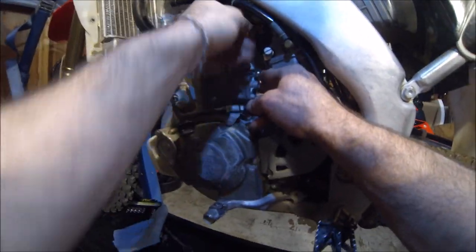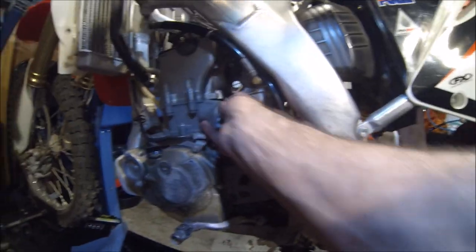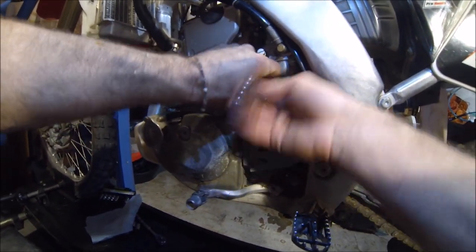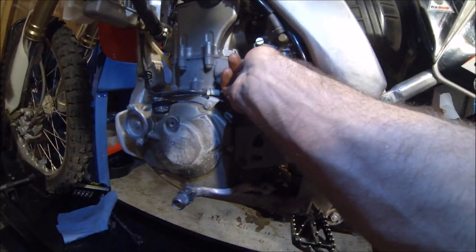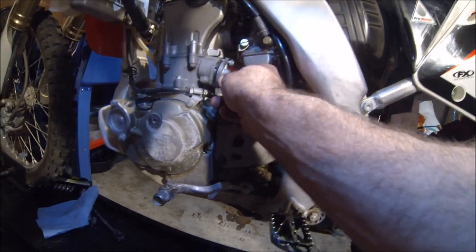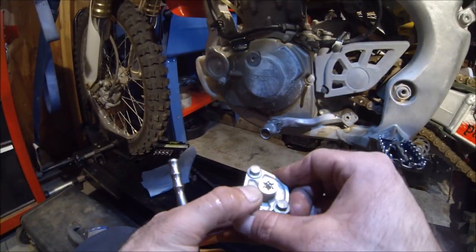It's a little bit easier. Leave the bottom one where it's at, that way you can take the top one off by finger. Go ahead and loosen it up here, try keeping it as even as possible. Okay, got that one loose. Make sure you can see there's a little dot that's going to face towards the left. Come time for installation, I'll show you how to collapse the plunger when it's time to reinstall this.